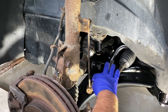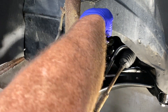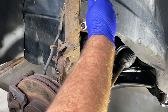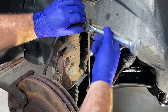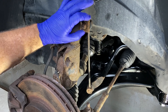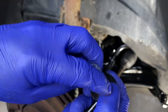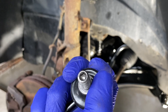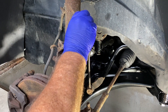All we're doing is undoing a nut there and a nut there. I've got a 14 mil. We'll crack it off with a hammer and see where it comes. Sometimes these can really seize, so we'll see what happens. Get the ratchet on it — and we've got away with this. Normally these are seized and you can't get them out. In the center there is an Allen key slot — you may have to get an Allen key in there and hold it whilst undoing the nut. This one's come away beautifully.